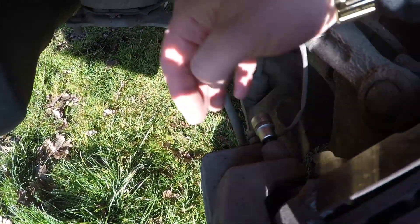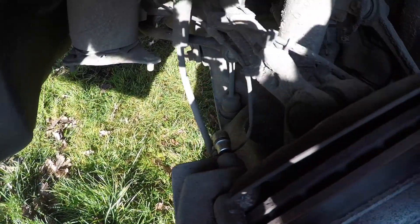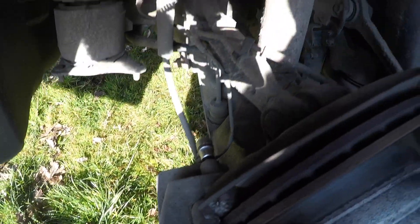With two 7mm allen sockets, as you can see here, that go on the back — just loosen those bolts like so and then the whole caliper will come off. After you've taken the caliper off, you want to then take off the carrier as well. You need to take the caps off as well, which are sitting right here.